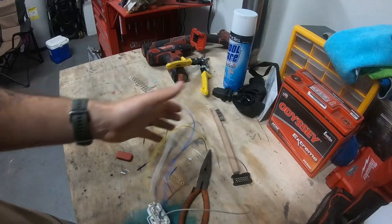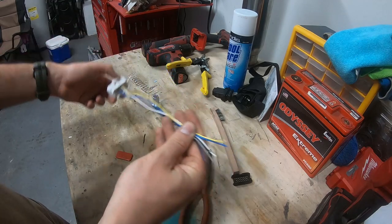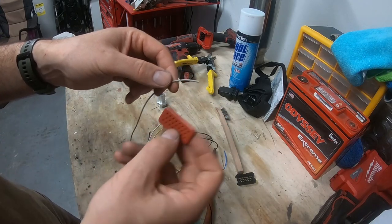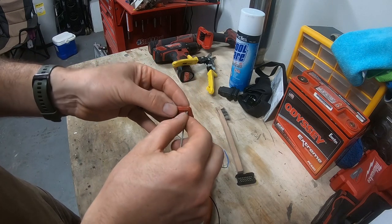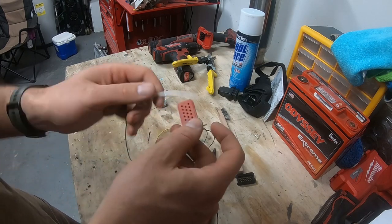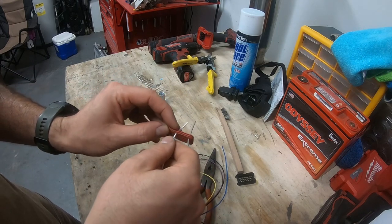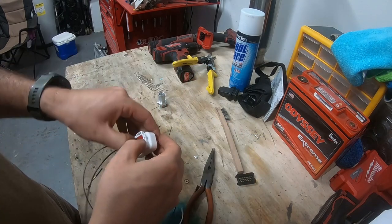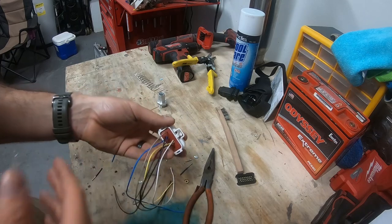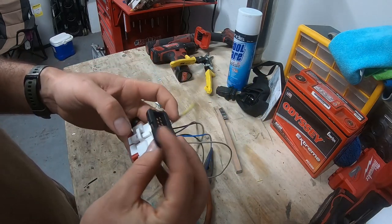Just kind of filling them up. So all the wires are in now, red piece is pushed in. I've got all of them and I'm just going to cut them to the same length. I've got my little red piece here and basically just going to slide these wires straight through. You just got to make sure this is lined up in sequence. Show that wire through there - we've got two, three, four, five, and six. I'd recommend before you close this up to basically just write down what analog pins you're using, what wire colors, and something like that so you remember when you're inside the car.